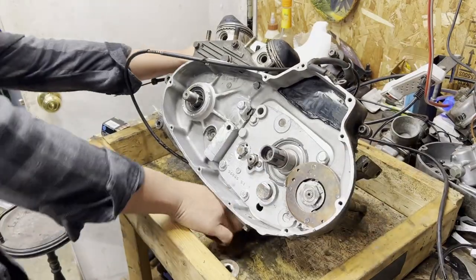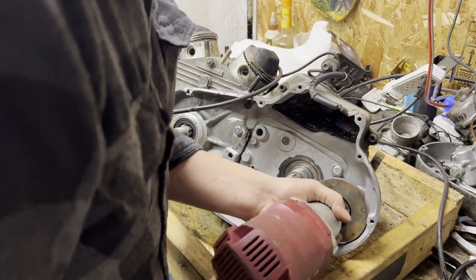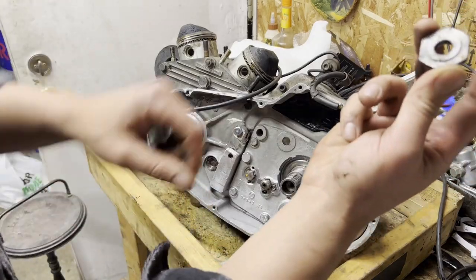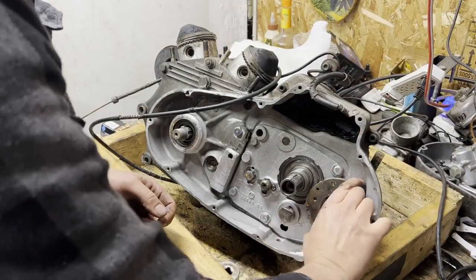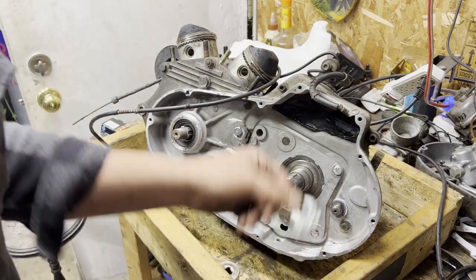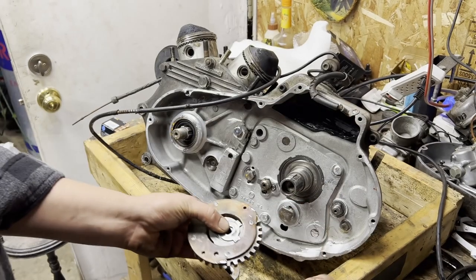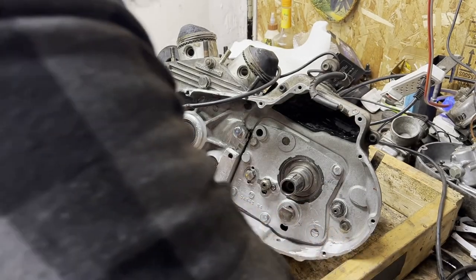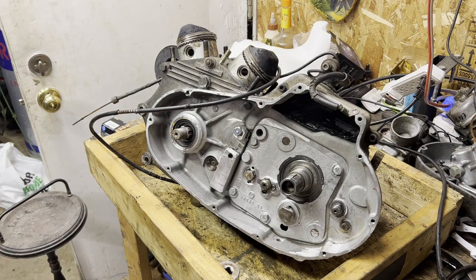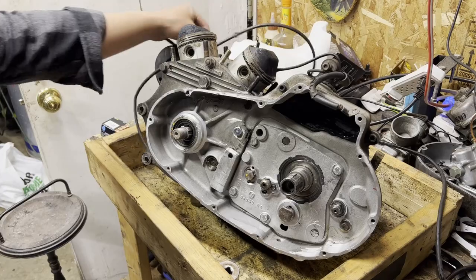It's kind of unfortunate that we are trapped in a box here, so we'll lay this over a little bit and throw another socket underneath for support. That's a lot tight on this motor. But there's your nut — you've got your stepped shouldered side and your flat side. Once that is free, we'll wiggle off the kickstart gear. The lock washer will get replaced. This gear I'm probably going to reuse — it's not in the greatest shape, but it's an iron head and kicking these over with slipping gears is not fun. Teeth don't look bad; it's just the stops that are a little worn.